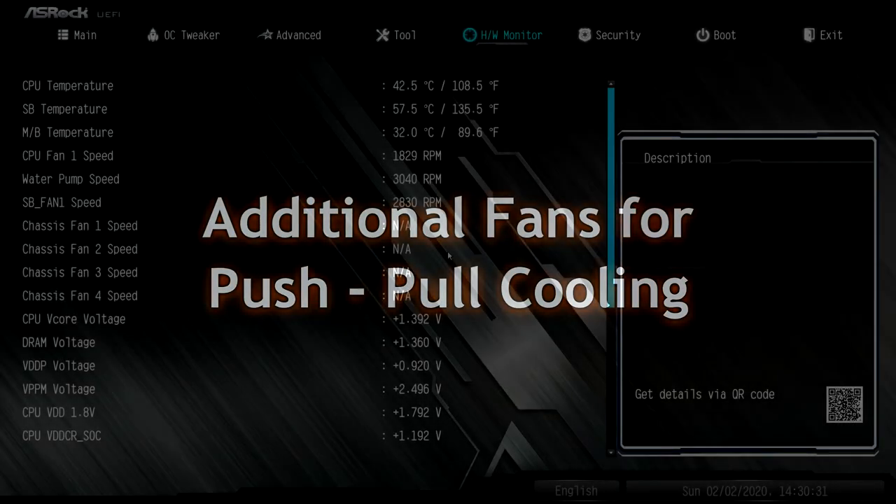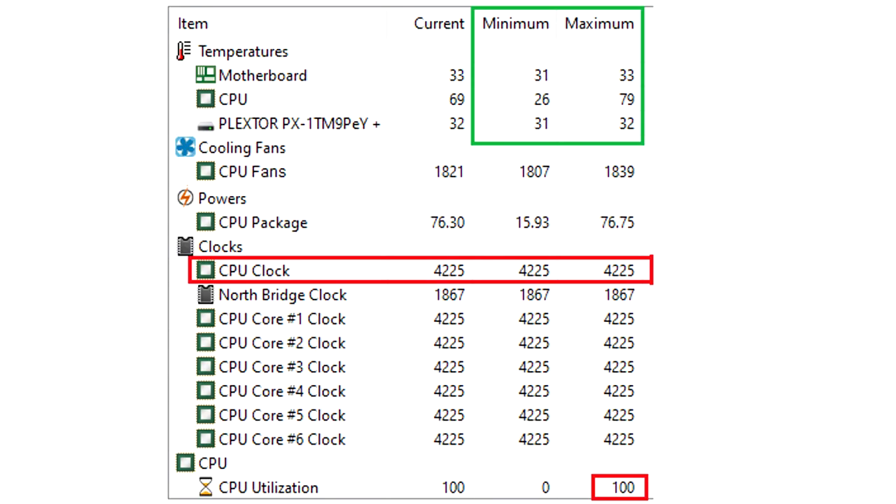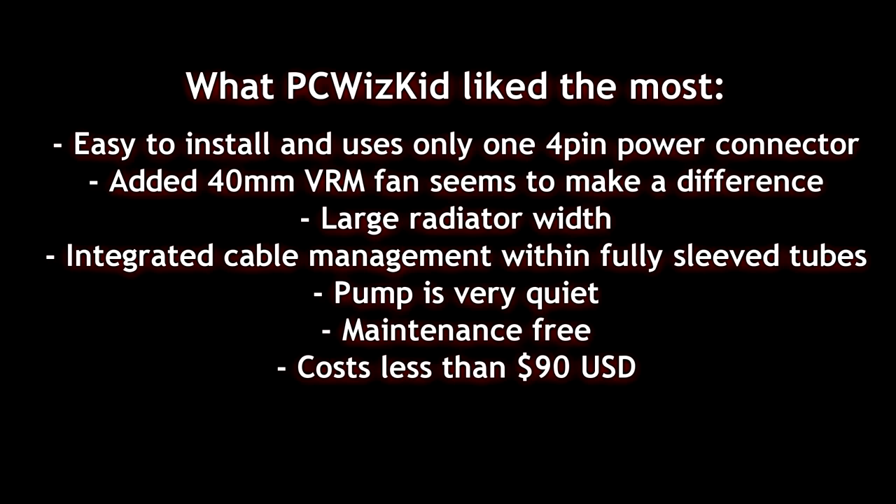You can see the board is also kept cool. If I add two additional fans for a push-pull configuration — four fans total — the CPU fan speed is locked at 1,800 RPM at full load. The temperatures actually go down a degree or two with the push-pull setup, so it is helping. The VRM fan that comes with the cooler is probably contributing another degree of improvement as well.